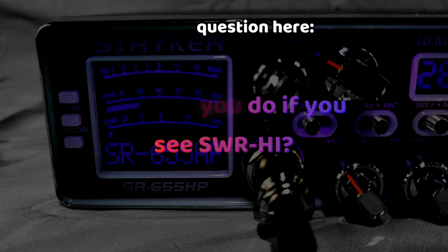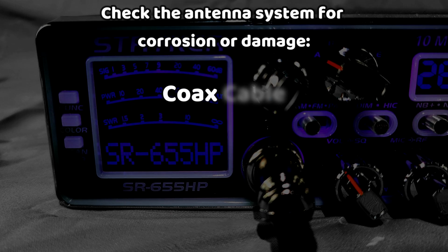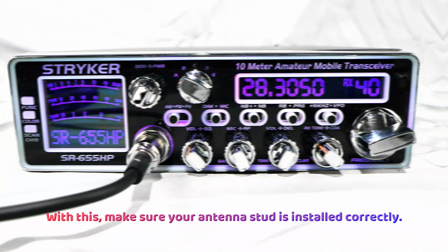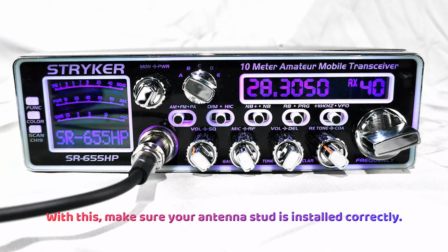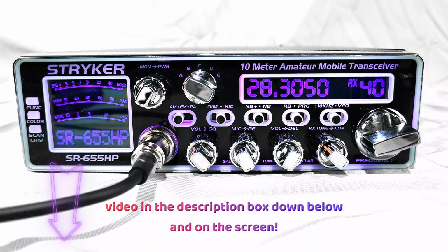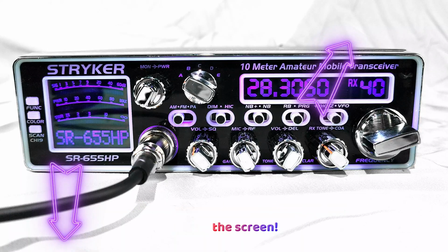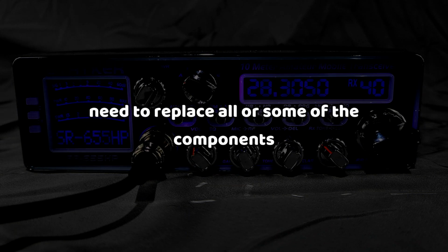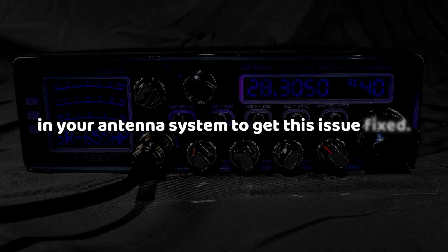You'll need to check the antenna system, so the coax cable, the antenna mount, and the antenna for any obvious corrosion or damage. With this, make sure your antenna stud is installed correctly. If you're not sure how, I've gone ahead and linked our video in the description box down below and on the screen. When you check, you may see that you need to replace all or some of the components in your antenna system to get this issue fixed.